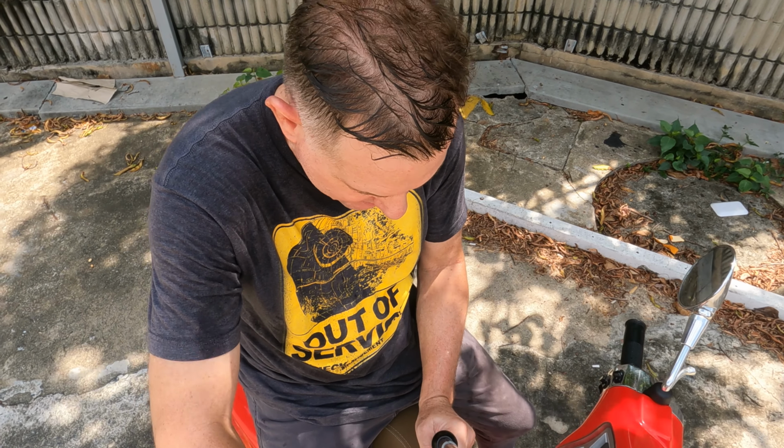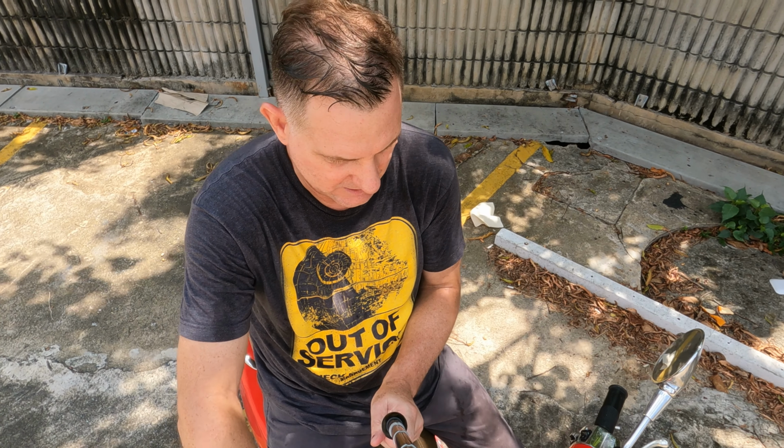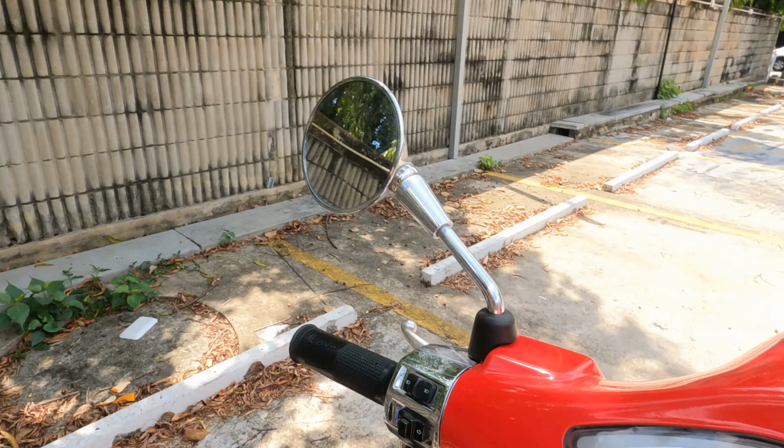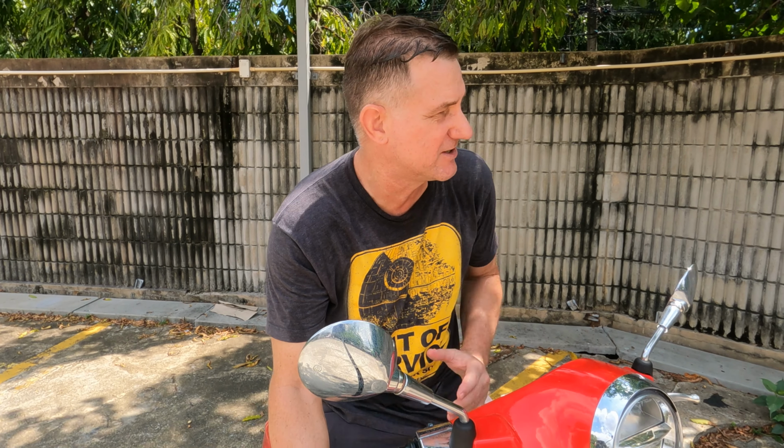If the electric readouts are all fine, you can then start up the engine. For that, I need to have my brake on, and then I put the ignition on. And now you'll notice that the oil light has gone off. You need to utilize all your senses here. So actually I'm listening. Does that sound normal? You'll know your bike and you'll know what sounds normal or not. So that's the next thing you're doing, just checking, is that engine running like it normally does?